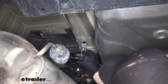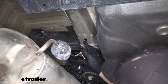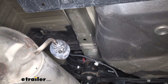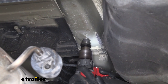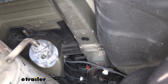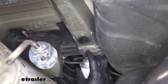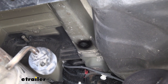This hole closer to the front of our car we're actually going to have to enlarge to create an access hole for our hardware to go through — this is going to go up inside of the frame rail. We're going to use a step bit, or you can use a hand file or a cutter tool, to get this enlarged big enough so that our spacer block and bolt can pass through pretty easily. Here's what our enlarged hole looks like — just big enough to get our spacer block and the head of the bolt inside. Since we have some bare metal from where we drilled, I'm going to take some spray paint and give it a coating to help protect that metal. We'll give that a few minutes to dry and come back to get our hardware in place.